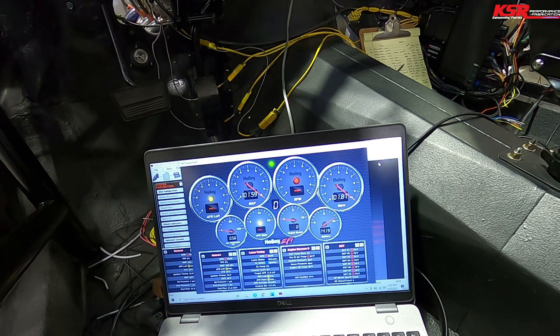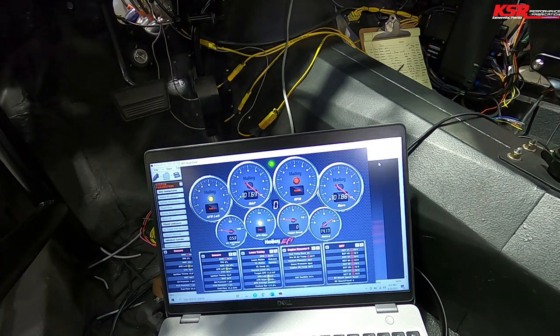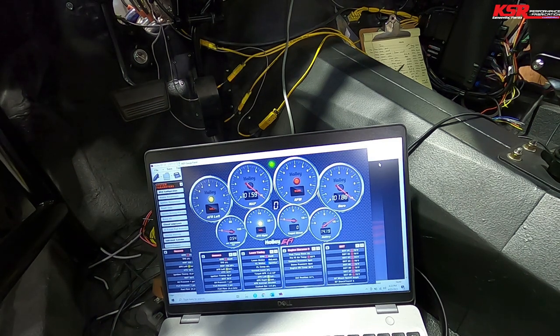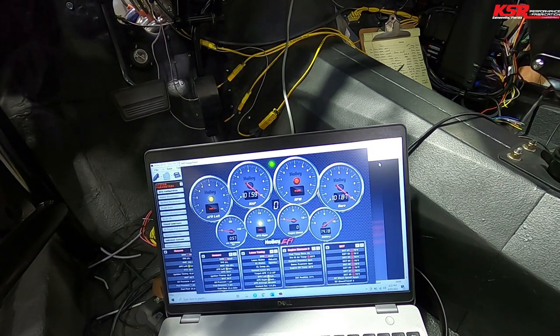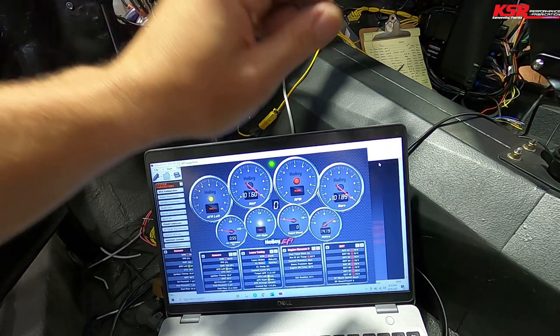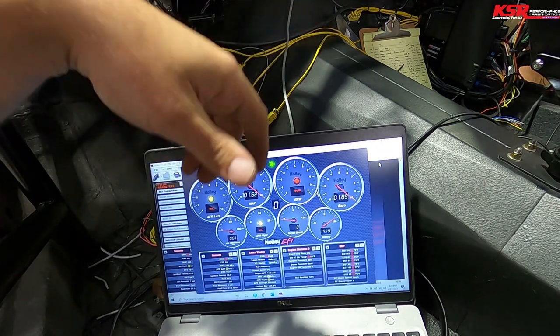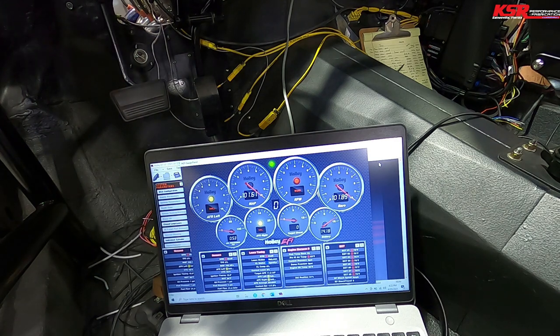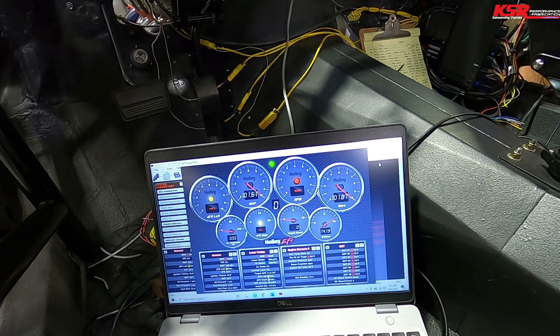All right, well, before you crank it, do you have shock data up? Yeah, it's showing 6. Hold on, I'm under it. Go ahead. Yeah, it's changing. Okay. I want to reprogram those to actually be by inch of travel instead of percentage travel, but we'll do that once we get a little bit closer to getting it out of here. Whatever it is at 6 is like near full droop.